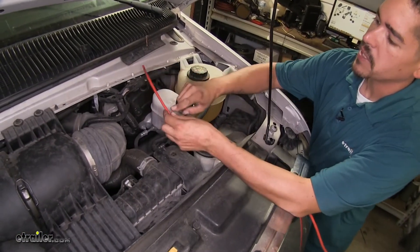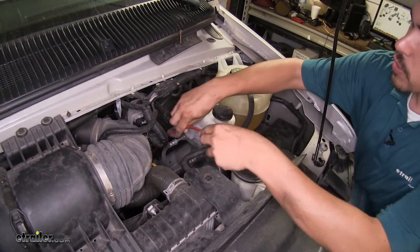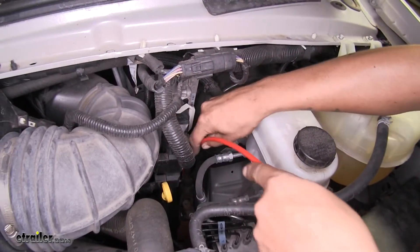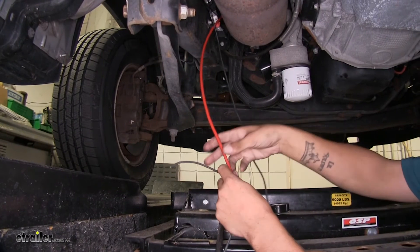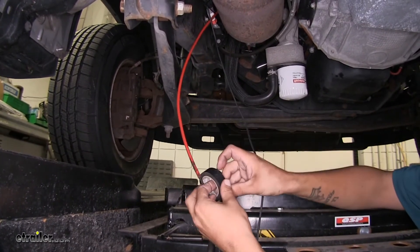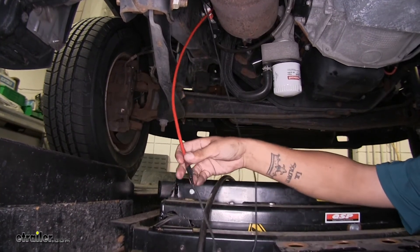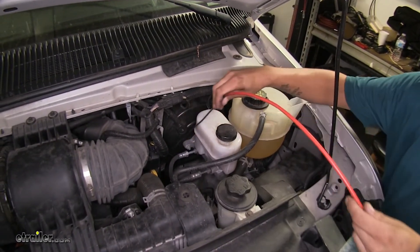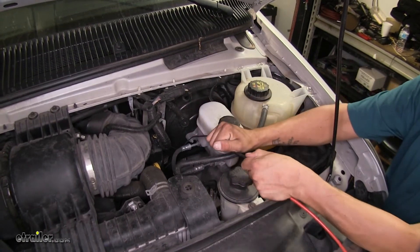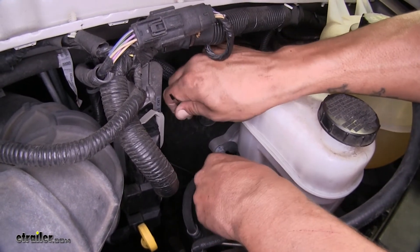In order to get the wire up, I'm going to take a piece of airline tube that I had laying around — you can use whatever you have available, even a coat hanger, something that's just going to keep its shape when you start pushing through. I'm going to feed my airline tube down through the engine bay until I can meet up with that wire down below. Here's where my airline tube dropped down, so I'm going to take the end of my wire and put it into my airline tube just a bit. I'll take a little bit of electrical tape and secure it so when I start pulling, it doesn't fall out. We can go back up top and pull our wire through, making sure to pull all the excess wire up and check underneath to make sure it's not getting snagged on anything. I'm going to take a zip tie and tie my wire right here so I don't have to worry about it falling down or rattling around when we're driving.